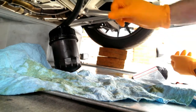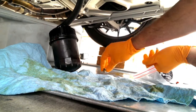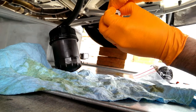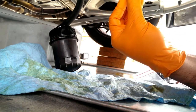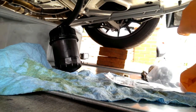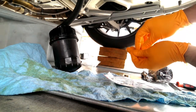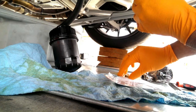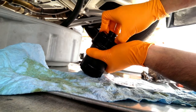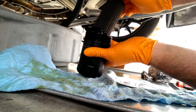Install the filter. Looking at it, it's got the o-ring there, so the o-ring must go up on the new one. I'm also going to take the old crush ring off and put the new one on. Take the filter, just clip in — it just clips.